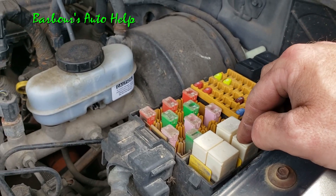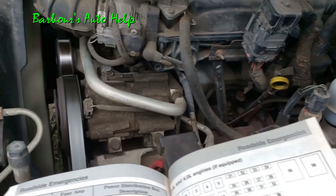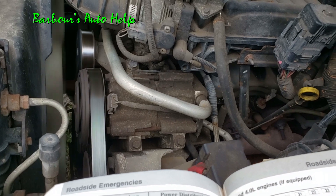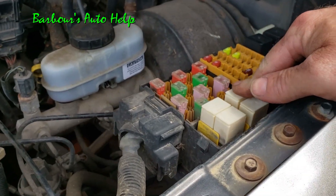So I took and swapped it with my washer pump relay, and I didn't have any problems whatsoever — no intermittent on-off issue or anything like that. So I just wanted to reinforce that that's actually a pretty good test to test for a bad relay.